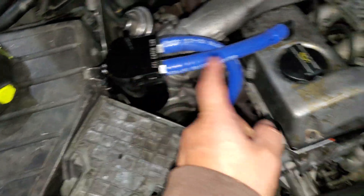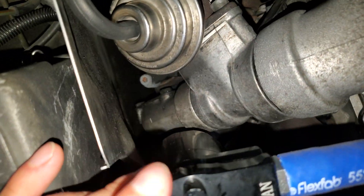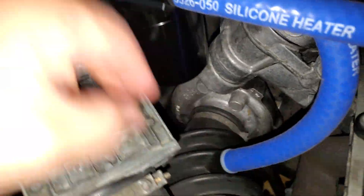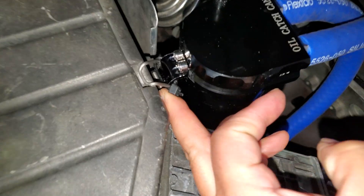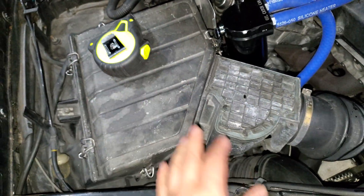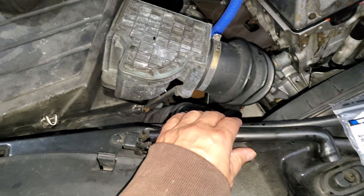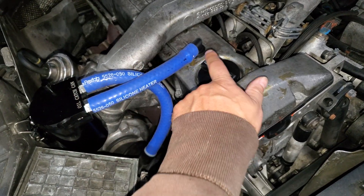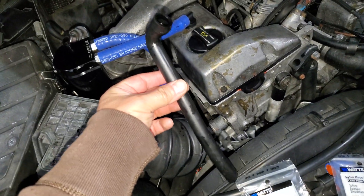This is a seven-inch length hose with a half-inch inner diameter, and the fittings that come in the package are also half inch. I mounted it and it doesn't bounce around or rub onto anything — it's free and clear. It holds pretty well with just one tie strap onto the clamp for the airbox. You do have to access this once in a while, every 10 to 20,000 miles depending on your area and how much dust comes through your filter.